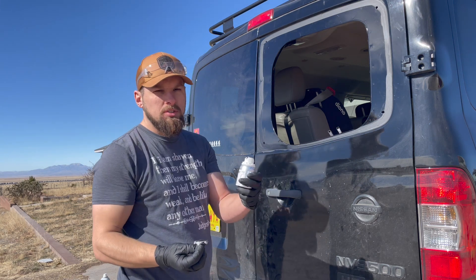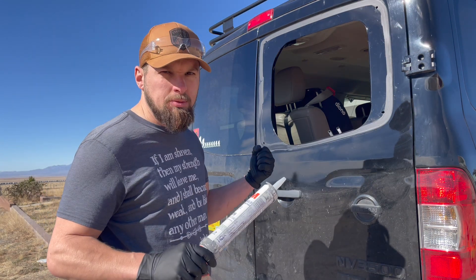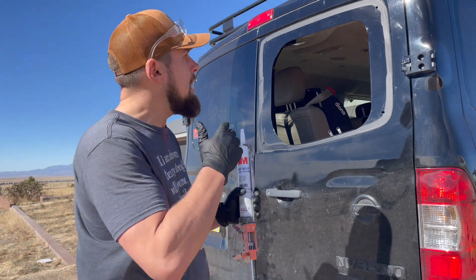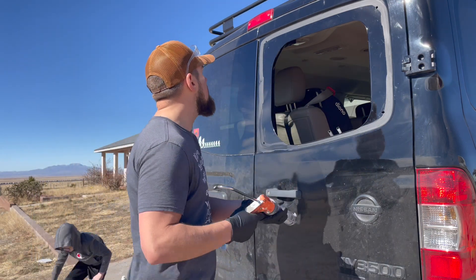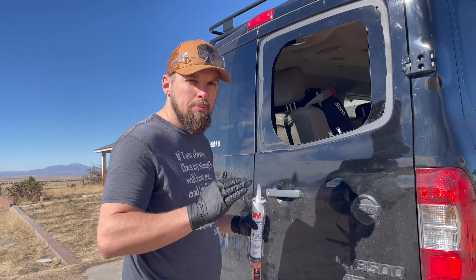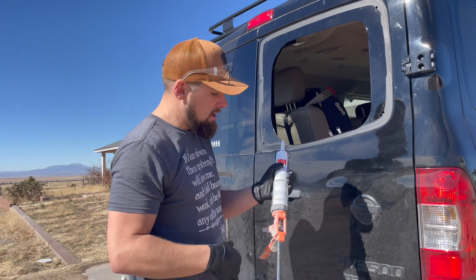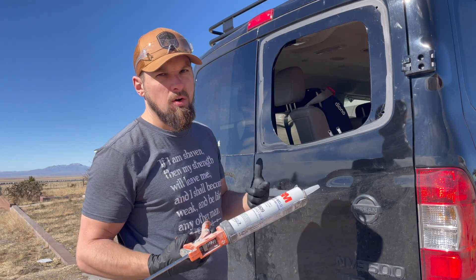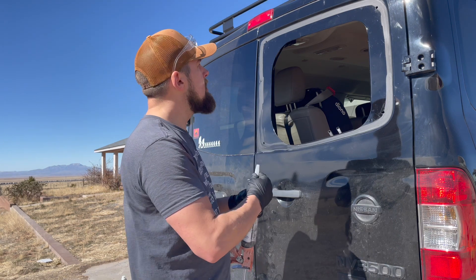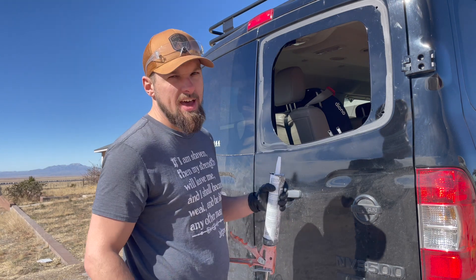This is pretty potent stuff — definitely recommend gloves. Here's my plan for doing this solo: I don't have any suction cups for the window. I just opened up the window for the first time and fortunately it looks like a perfect fit — right color. I cut a pretty big hole in the caulking gun because I want to get a really good bead for adhesion and to keep water out. I'm going to pre-tape the window, hold it in place, and wrap tape up to hold it. I'm going heavy with the adhesive because you can always squish it down, but it's hard to fill a void back up.